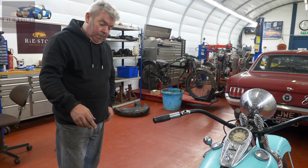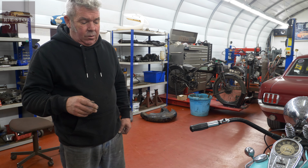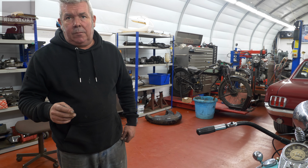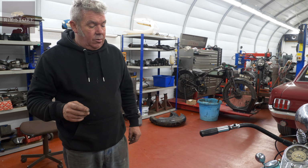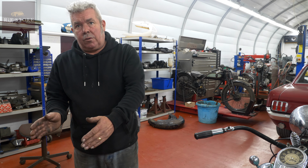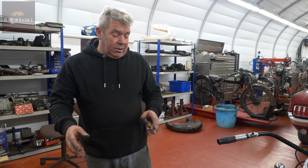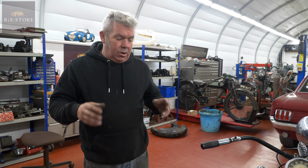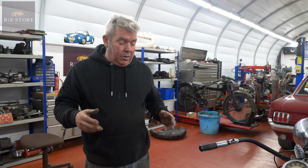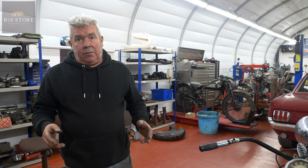If you go earlier, you've got a 3-bolt and a 2-bolt gearbox, but the 40 to 41 2-bolt gearbox, you hardly ever see any of that. You really don't see them, you know what I mean? Because they're very, very collectible. They've got the narrow clutch case, different size rear spread on the rear of the forks, all that sort of stuff. They're quite desirable, and they didn't make many of them. Obviously, they're probably the same frames when you go back to a '39, '38 RL and things like that, but most of what you'll find, i.e. what we deal with and what most people have got, is a 45 WLA or derivative, a civilianised one of them. So most of those are '42 up.